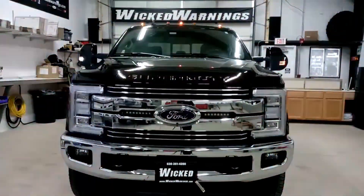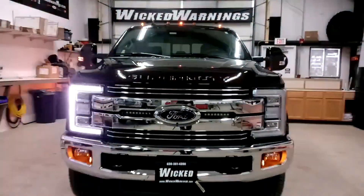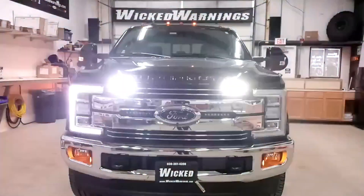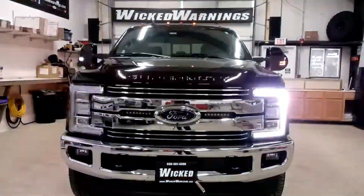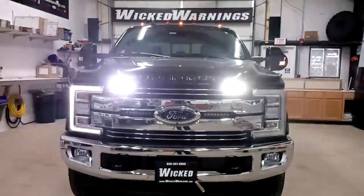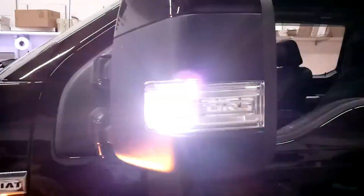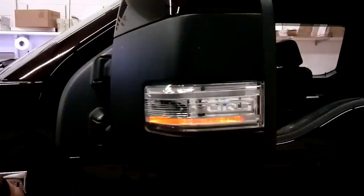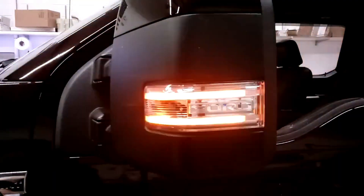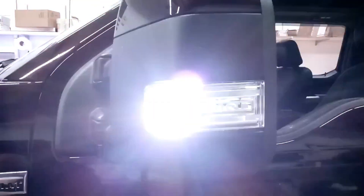You can also see those razors in sync on a nice alternating pattern and you can see how we split the roof up with the auto flasher. Now if you wanted to go simpler with the auto flasher, you can elect to flash all five lights on the roof quickly at a high rate of speed without splitting them up and shave a lot of time off your install — email us in and we'll tell you all about it. A little close-up of the mirror right there — you can see between the white and the orange in the mirror alternating nicely. Triple flash, 75 FPM — synchronized the mirrors together for the white and the orange to alternate on each side.